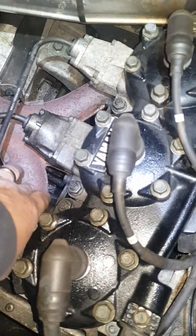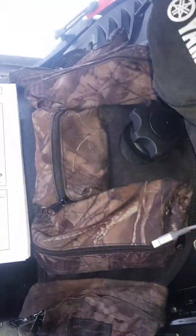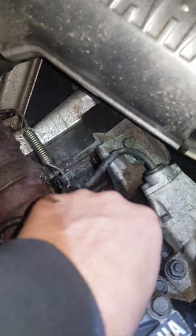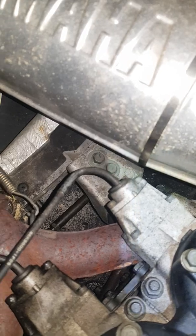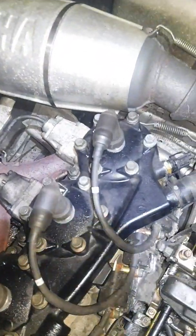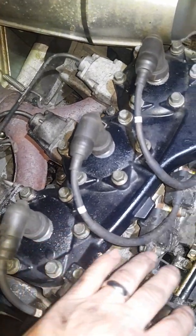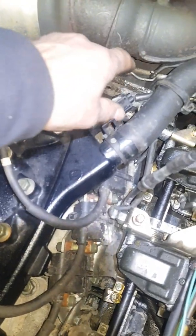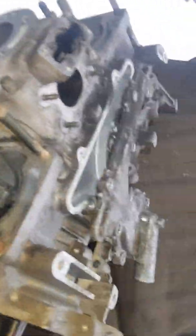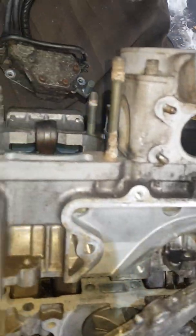Once you get the engine out, you can only get a couple of these nuts off with sockets and extensions, but a 10mm tilting ratchet is the way to go to get these off because they're in there tight. Make sure you have separate baggies — a baggie for certain nuts and bolts, and a baggie for the stator. When you take that stator out, don't lose the key — that's easy to drop. Keep a separate baggie for all your nuts and bolts for each part of the engine. The next video will be disassembling the engine, splitting the crank, and doing a top end.